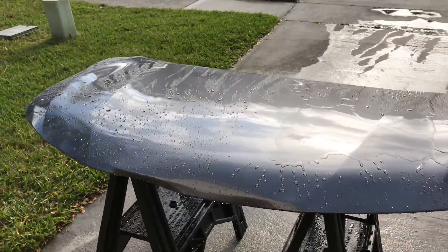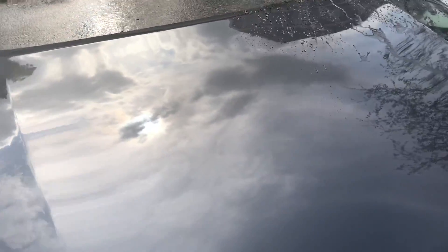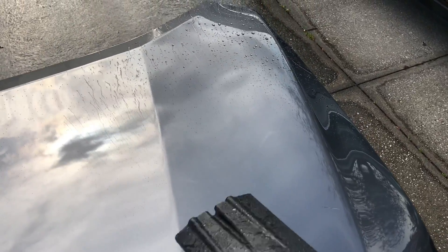Another benefit of a high hydrophobic surface is the air blower — when you're drying, it can completely blast the water beading off the paint, so it's much easier to cleanly dry the surface without having to go back with the drying towel afterwards. That just helps reduce the amount of hard water residue that can be left behind on the surface. On a less hydrophobic surface it's going to take more effort with the blower; it can't easily push the water off, and we're going to have some evaporation that occurs as a result. Evaporation combined with hard water is going to leave behind more hard water residue. If I'm working on paint that's less hydrophobic, what I'm going to do first is get the hose nozzle out, switch to the flutter setting, sheet the water off the paint first, then go over with the drying towel, and then blow-dry out some of the edges and creases. On the areas of the paint that are crazy hydrophobic that I've coated, I can just go straight to the blower — I don't have to sheet the water off first.